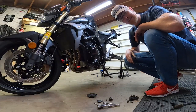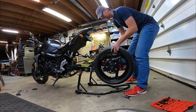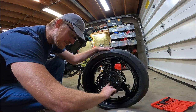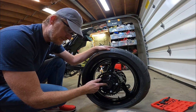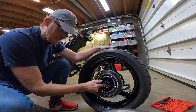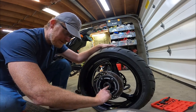What's next? Rear wheel — let's go. Oh, it looks so pretty. Before I do this, I've got to put some grease in here. Pack it in — don't be afraid. Certainly won't hurt anything. I just try to keep the excess off the outside so it doesn't attract too much dirt. Grease is your friend — don't be afraid of grease. I've got my chain adjusters all the way forward. I need my spacers nice and clean.